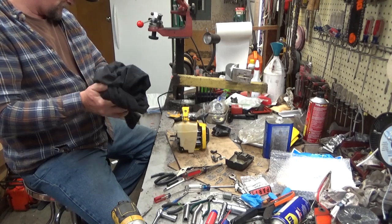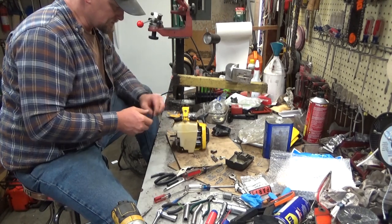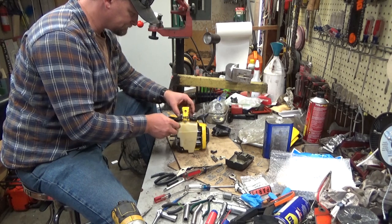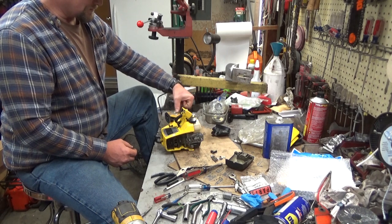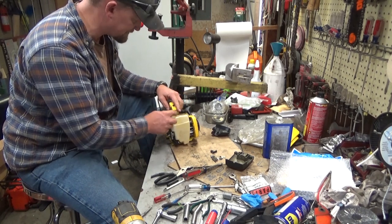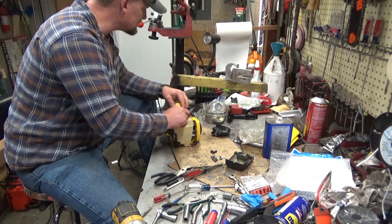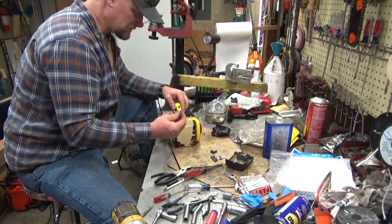At this point, we're just going to keep going and get this front end buttoned up. The manual oiler on these saws is not very complex. It's retained in the tank up here, and it's actuated with this little rod. It's set up so that you can use your left thumb as you're holding on here to do the manual oiler if you need to. The automatic oiler is adjustable. That's what that screw is. So generally, I haven't found the need to go manual a whole lot. Not to say that you won't, but I haven't found the need. And that screw definitely didn't belong up there.